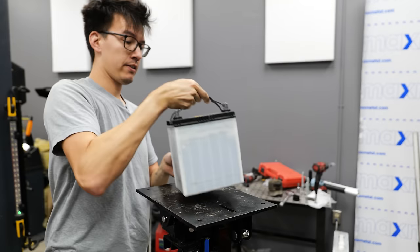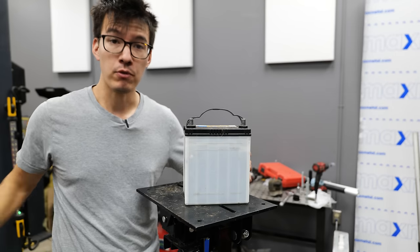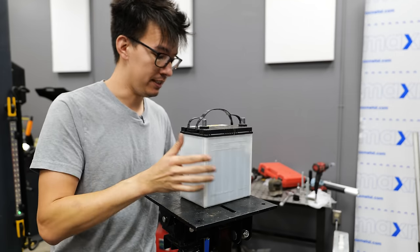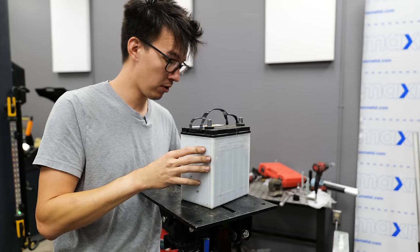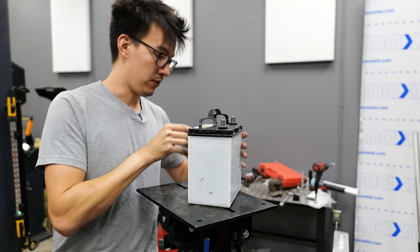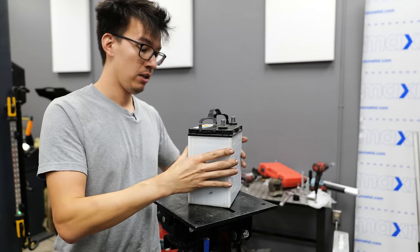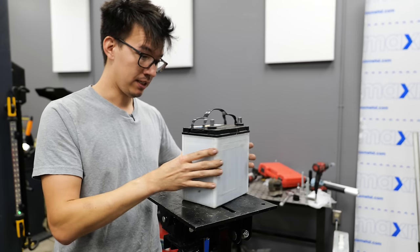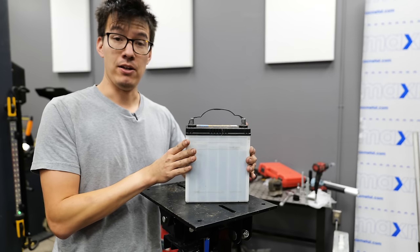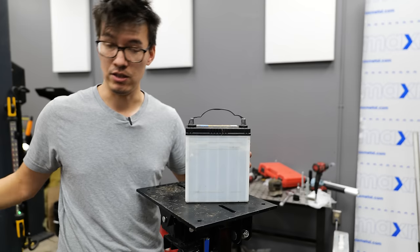And last but not least, we need to replace the battery. This guy has been going out even before the car got flooded, and unfortunately, it is a Hitachi Tuflong Super. There's a bunch of Japanese writing on top of the battery, and there's a little spot where you can initial how many kilometers were on the car when you installed it. Meaning that this is definitely a Japanese market battery, and they are not going to sell replacements for this style of battery here in the US.